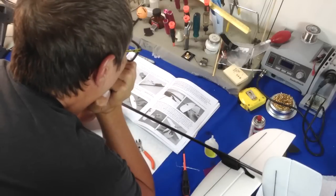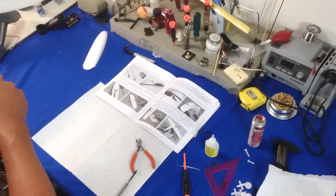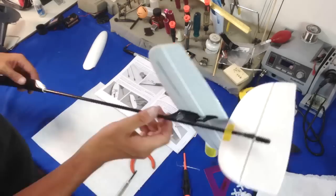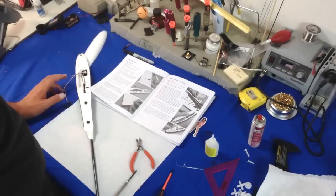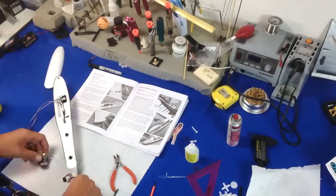I do have to read the instructions from time to time. What I'm noticing on my elevator is that as the rod gets pulled, it tends to hit the little plastic area it's kind of enclosed by. So I took it and ground off the very tip of the clevis screw that screws through too far. That's all I did right there.